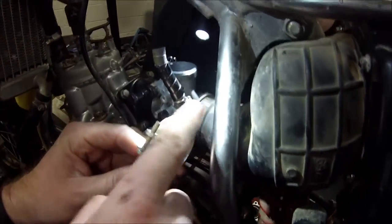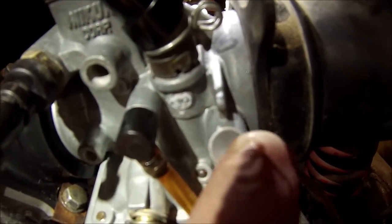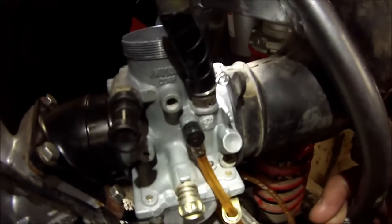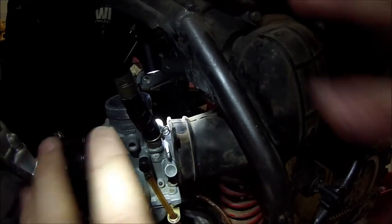When you go to put the clamp in place, take a look — you can see how it's closer here than it is up at the top. What I want to make sure and do is manipulate that until it's nice and even. Before I go to tighten the clamp, can you see where my finger is pushing on the airbox? Hold it in place, then clamp it. When you let go it's going to be fully clamped on the carburetor and the rest will settle itself.